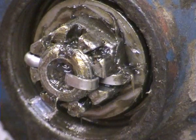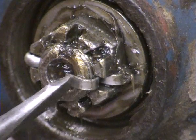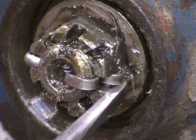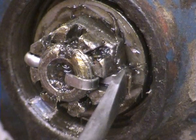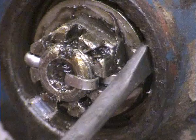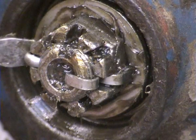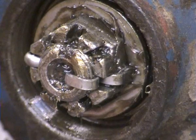This is what we should end up with. The top leg has been actually bent round the actual stub axle, and the bottom leg has been bent round the other way, but it's been cut short so it's not actually protruding. There's only danger of it getting into the bearing and getting chopped off and breaking up parts of the bearing, damaging the bearing. Also note that the head of the split pin is nice and snug down in between two castellations.